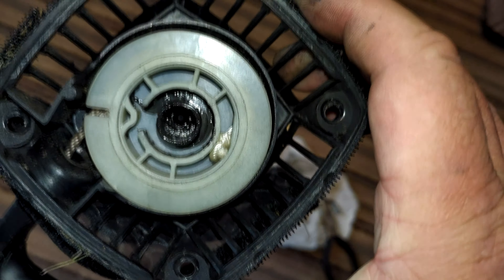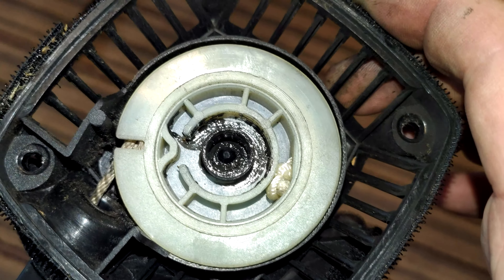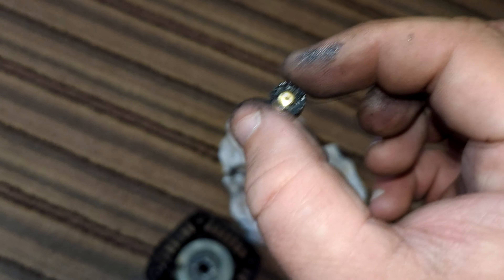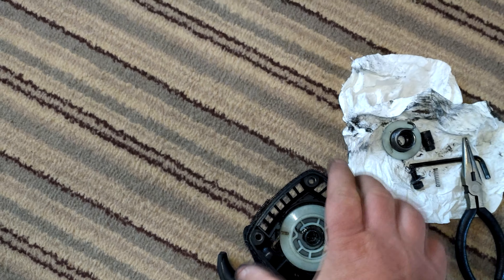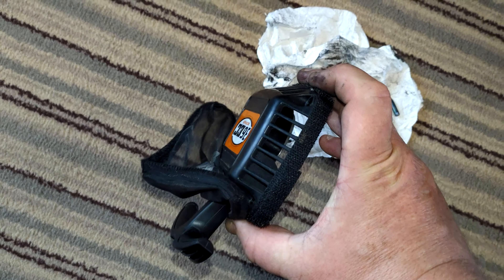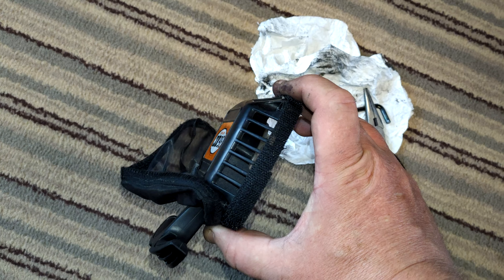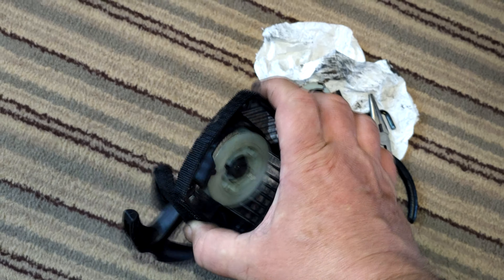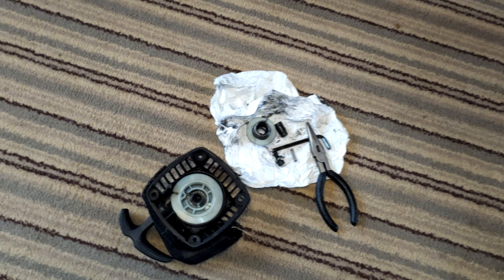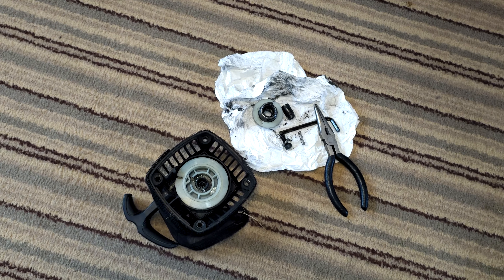You could just replace the black plastic part of the pull start. But I'm going to see if we can drill all the way through there, take the brass insert out, put a longer bolt all the way through to the back, put a big washer on it with a lock nut, and then set the gap so it can't fall forward. Because it's held all the way through to the back with a big washer and lock nut, it should be a lot stronger and might last a bit longer.